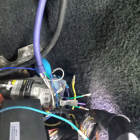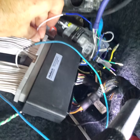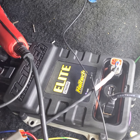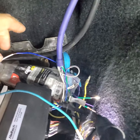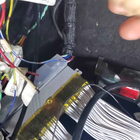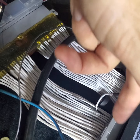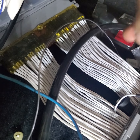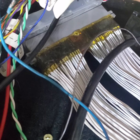But for the thermal control, doesn't matter. We're just going to turn it on with the Haltech setup. So I'm running a Haltech Elite 2000. Badass so far. I'm running it to the factory harness here. I'm using a Wiring Specialties full harness for the RB25 Neo, and I went ahead and got the patch panel just because I knew we were gonna have to tag off of here and go into the body harness and some other stuff.